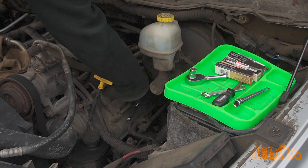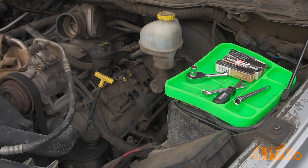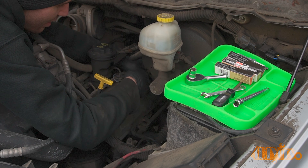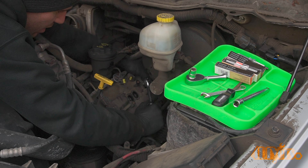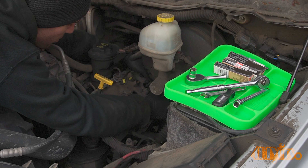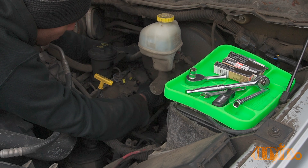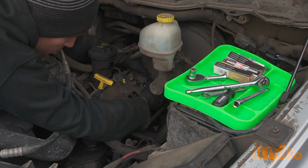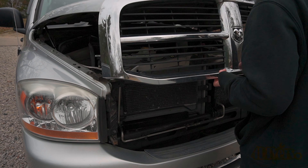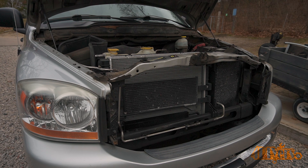You may notice some slight differences in the video footage along the way as I did run into a problem. I'm not sure when the last maintenance interval was done on the plug replacement. Many of these plugs were seized, so I was required to put everything back together, take the truck for a drive to get it up to operating temperature, and then pull the coil packs again. With the engine still hot, I immediately loosened all the spark plugs, as this is one of the ways of dealing with seized spark plugs. If the spark plugs are hard to remove in the heads, it's extremely important to take your time and have patience, as you can strip the threads causing an even bigger problem.